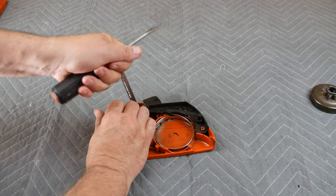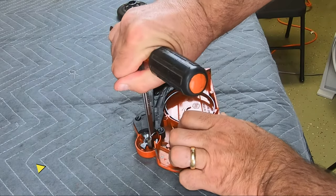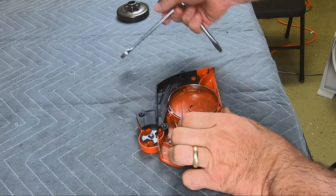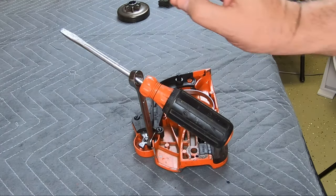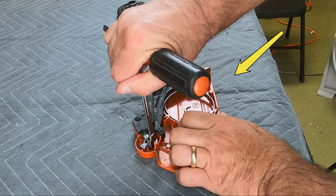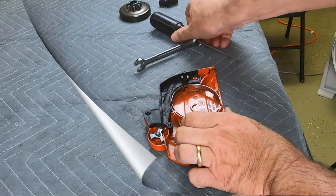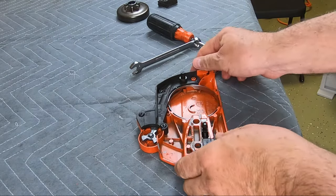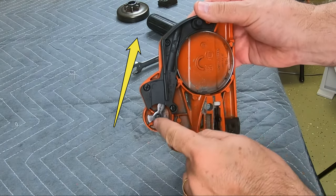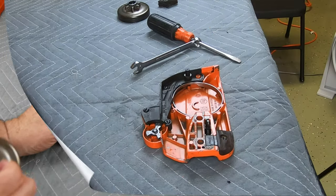Now if you don't have your cover in a vise, you grasp it tightly with one hand and turn the mechanism clockwise, like this. Now watch it one more time, but this time pay attention to the expansion of the metal band at the arrow. Did you see the circle get larger? Take note of how the mechanism is now in a straight line — the brake has now been disengaged and reset.